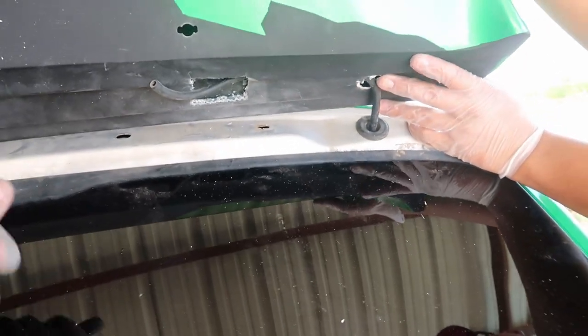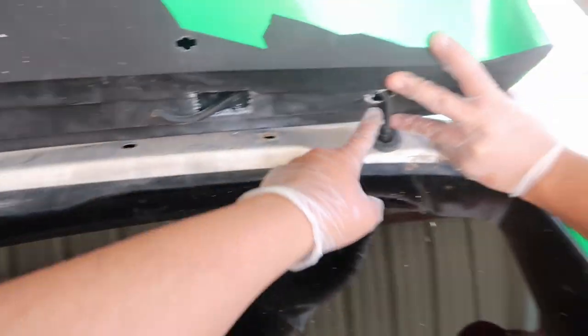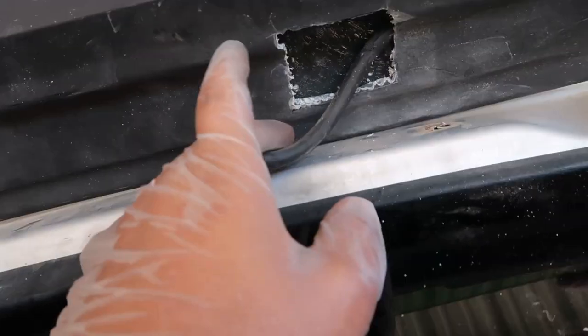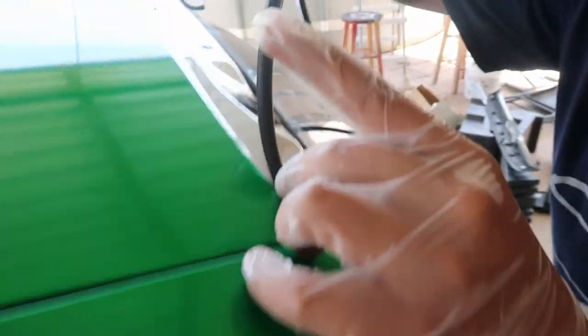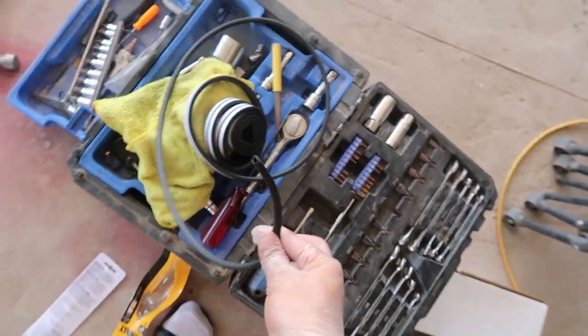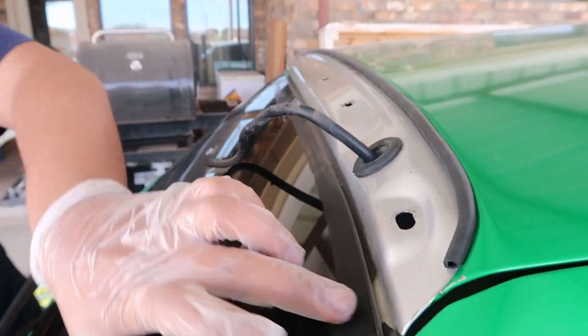I'm doing this so I could remove it and install it again if I ever need to. That's the hole that goes here. This is the hole I made so I can actually put the nozzle in. To make the extenders a little more accessible, we could get some pliers in here to squish the washer fluid clip in case I ever want to take it off. Now I'm putting in some weather seal — you can get it at your hardware store, it's just rubber strip — and when I wash my car we won't get water in here. I'm going to put another strip across here.